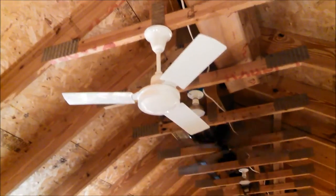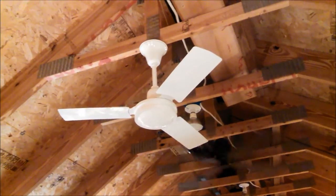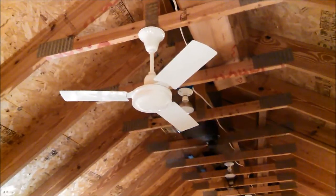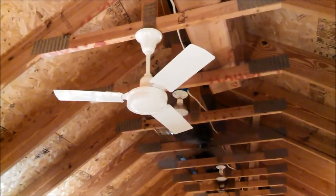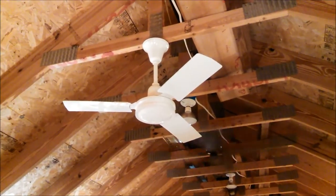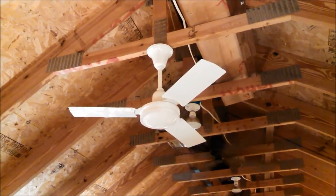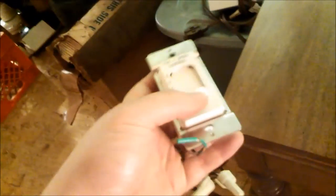Hey, my phone died in the middle of the last video, so this is starting over. I figured I was going to try some more controls. Also, somebody had asked me about the lighting in my video, so for the second half of the video here, I have all of the overhead lights turned off, so you can see just what the side lighting is. And I'll do a video later to show what all that is, provided my phone battery doesn't die too many more times. So we're trying it here with the 4-speed control with the 8 microfarad for low, 8, 12, 20.